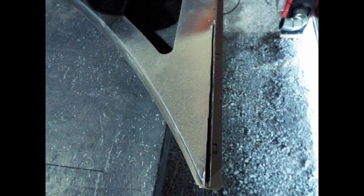And because the 22 Ranger was going to have a tonneau cover, I could not put the Kargo Master rails on with that tonneau cover, as the Kargo Master chase rail clamped onto the side of the rails. Well, that's exactly where the tonneau cover rail goes. So I was going to have to bolt the Kargo Master chase rail to the top of the truck bed rail. So I started off by cutting the mounting plates away.